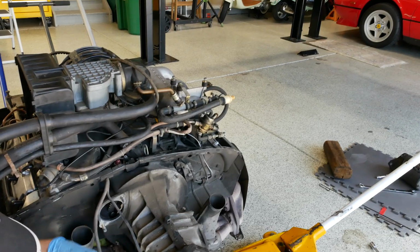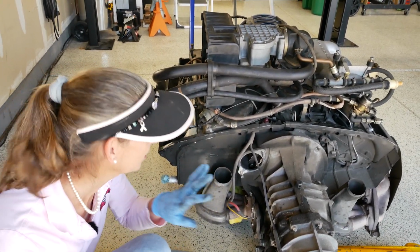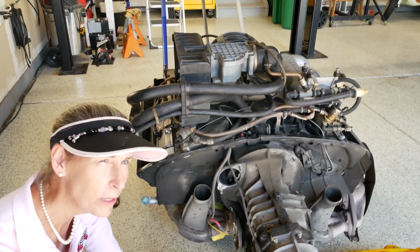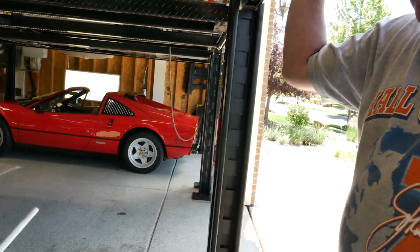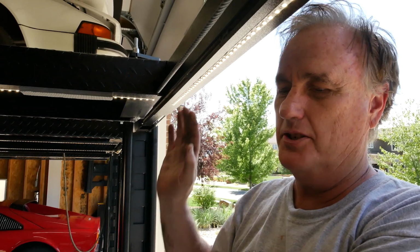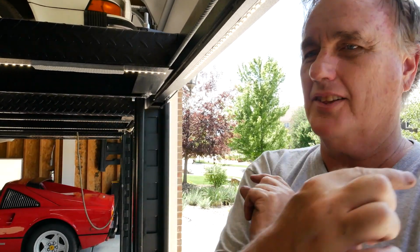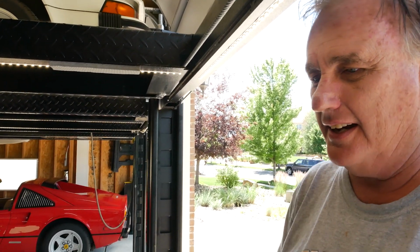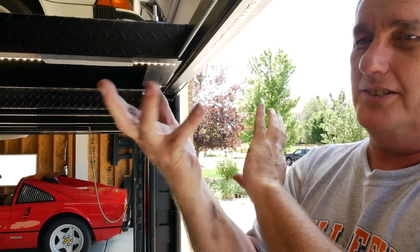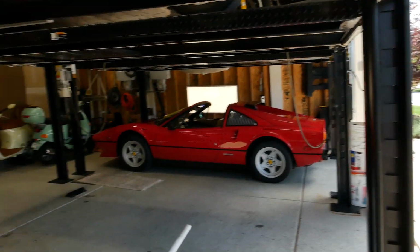As we've done so many times with this project, we're going to bring in our ringer again, bring in Doug. Is there a special way we need to separate this? If I remember right, you've already got the key piece. It's where the disengagement goes into the throwout bearing. That has to slide out of the slot. If you'd left it in the car and it still had the rod on it, that's where you get into trouble, because you can't twist everything. So we should be able to just pull it out then? Okay, all right, this will be exciting.